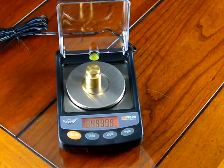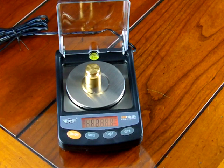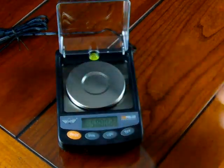Another feature is the ability to turn the backlight on and off. The scale has an amber color backlight. Press the light key two times. First we saw 'scale,' now it says F1. When F1 appears, the light will automatically turn on when there's been a change of ten divisions. Press the unit key to F2 — the backlight will always be on. Press again to F3 — the backlight will always be off. To save battery power, we'll select F3, then press the tare key to store it. The scale exits configuration mode and now has no backlight whatsoever.